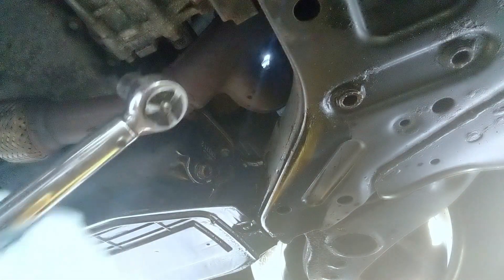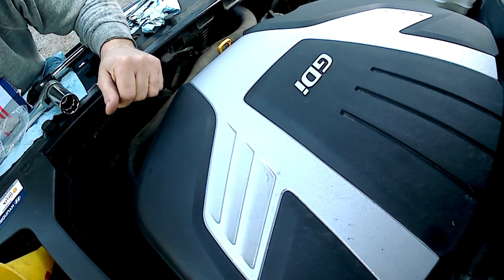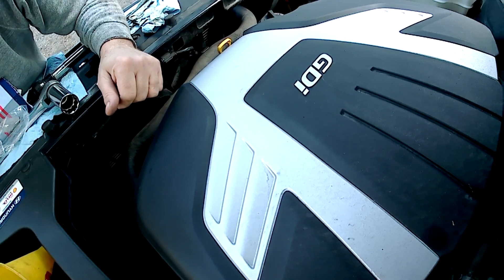If your car has a specification for how much to tighten the bolt, get yourself a torque wrench. I set my torque wrench to the specification — 30 Nm thereabouts. You can do it in SAE or you can do it in metric. And when it clicks, you're all done. Continuing with the Santa Fe oil change: we drained out the oil, put a new washer on the drain plug, and torqued it back to specs. Now we're up above.